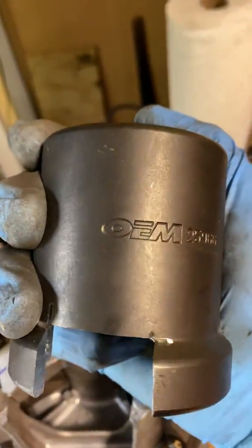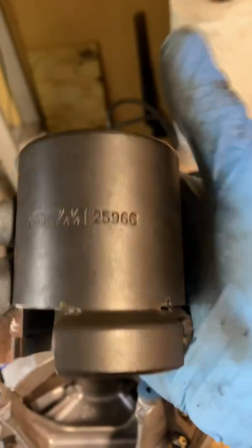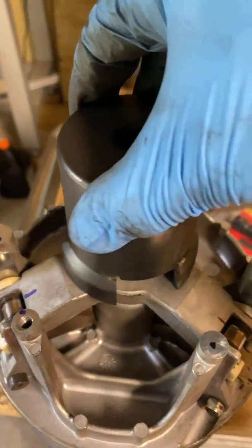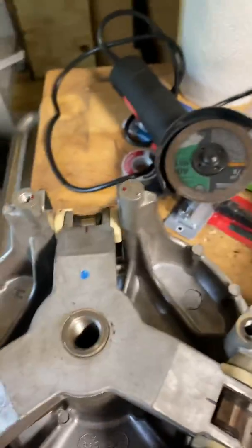I just made a remover. This was some kind of tool from the auto parts store that was big enough to fit over. I got my grinder and originally laid it on top here and drew where the spider legs are. Of course it fits on like that — put that on, twist it off, and you're done.